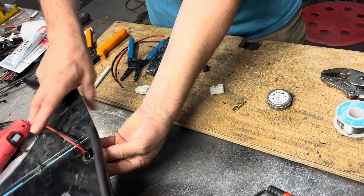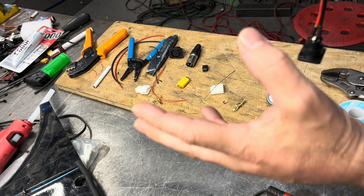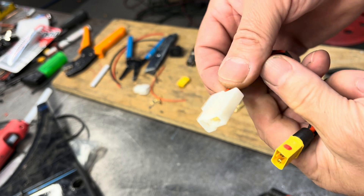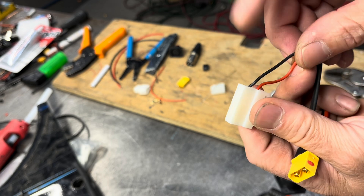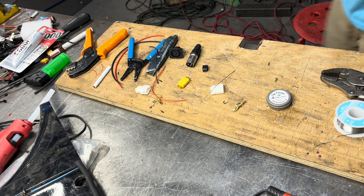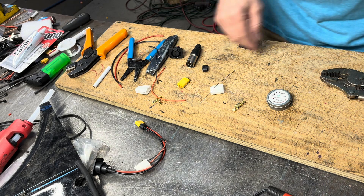Let's get started. We're going to be making this piece right here. The whole point to having this connector is for the battery — when you put the battery inside the bike and want to take the panel off, it's just a quick disconnect. This will be for my 12-volt supply and this will be 84 volts and 72 volts fully charged. The negative connects to everything. This is for the charger. I like this system because it comes in handy if you ever have to take your battery out or just remove your panel — it's nice and clean, saves a lot of time.